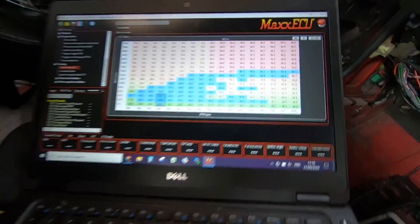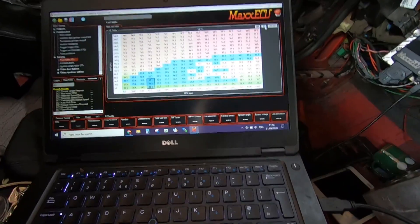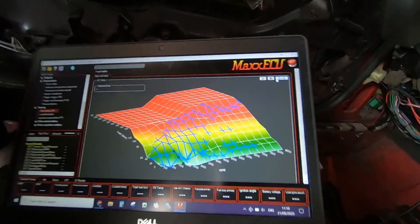As you would have seen, this thing is nuts - I had it revved up to around 8,000-8,500 RPM and the shifts are just ridiculous. I'm going to go over the tune - I've made some changes to these areas and I'll probably have to go and smooth it out, because if you look at the 3D map it's still a wee bit all over the shop, but that's no issue. I've still got to fine tune a little bit when it comes to the downshifts - because below 3,000 RPM it's fine, you click down the paddles, it'll auto blip, it always catches. However, further up in the rev range, like 6,000-7,000 RPM, changing down it blips, however it doesn't blip enough I don't think.